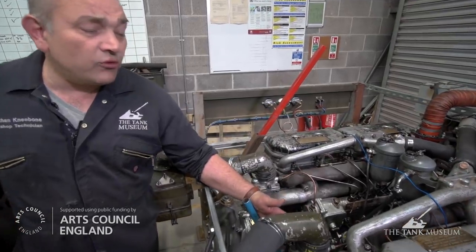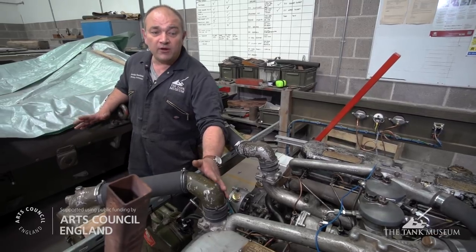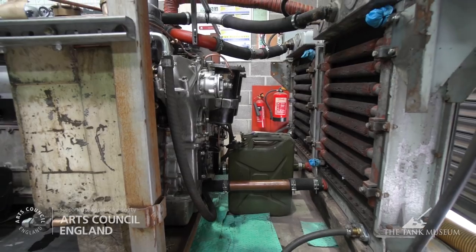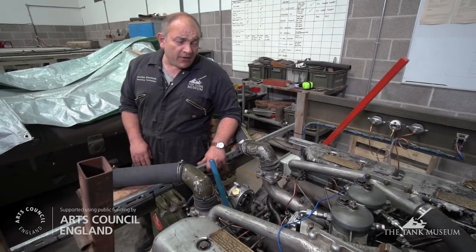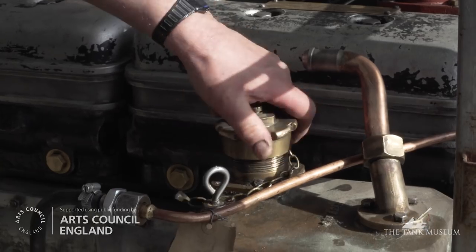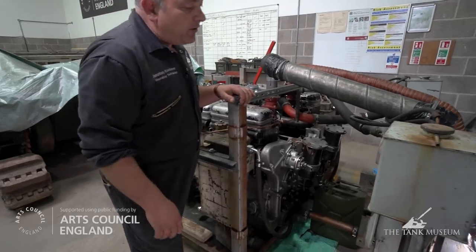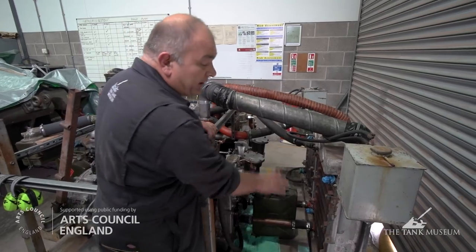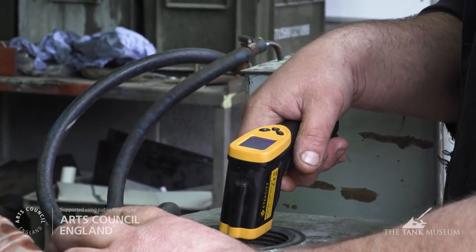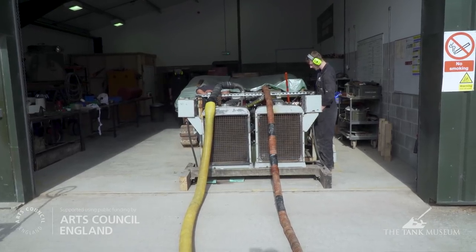It's an important point that everything I talk about is doubled up — one for the left hand engine and one for the right. We always describe things in a tank as if going from the rear of the vehicle, so everything on the left hand side is actually on my right as I look at it here. We need fuel, and we've got diesel in jerry cans with special adapters that plumb straight into the fuel injection pumps. For lubricant we're using the original oil tanks, mounted so we can test that there are no leaks in the copper piping and that the shutoff valves also run dry. The coolant pack at the front maintains the engine at constant temperature, made up from old radiators — and the reason we've done it independently of the vehicle radiators is so we can utilize this cooler pack when we run other engines. The exhausts are doubled up one for each engine and we plumb them to the outside.